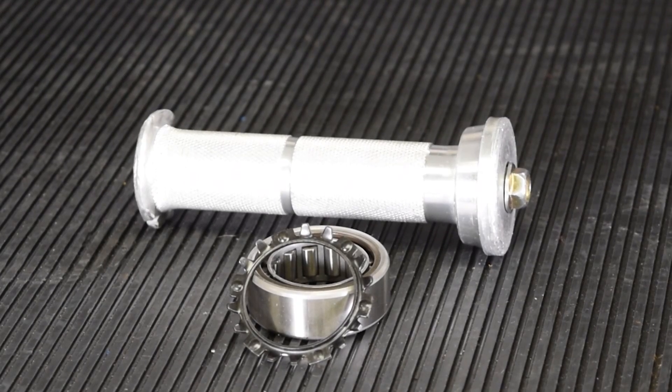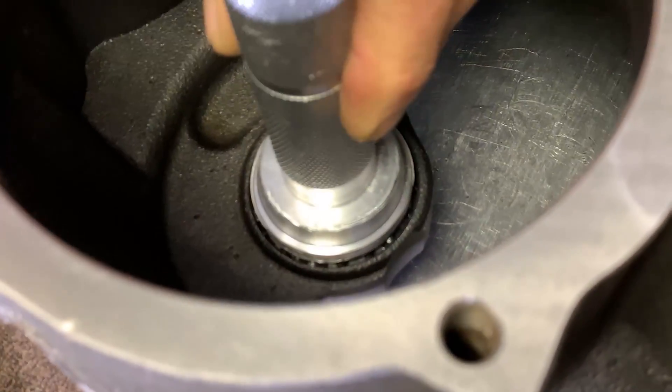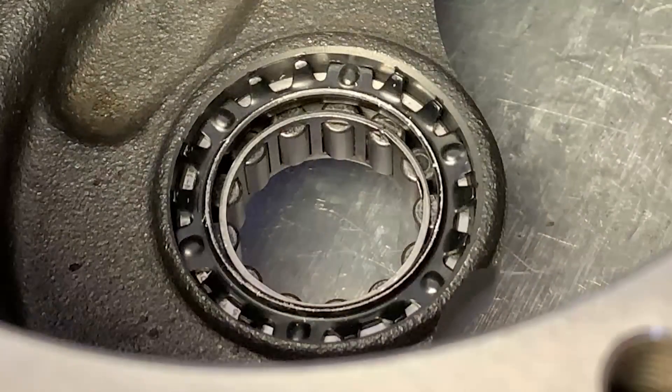The pilot bearing is a unique and key component that adds strength to the Ford 9-inch by reducing deflection in the pinion gear. This is especially critical when the ring and pinion gears are under heavy acceleration or shock loads. The pilot bearing is pressed or driven into place, followed by a retaining clip.